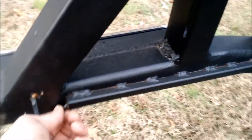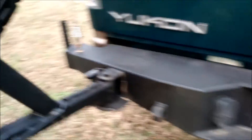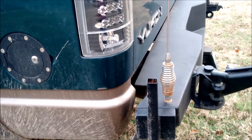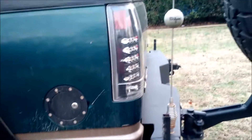To tidy up my wiring, I took some quarter-inch square tube, welded it down here alternating up and down for my wiring channel. On both sides of the bumper I have flag mounts — I drilled holes in the bumper, built a box, and it fits a copper tube inside a one-inch tube. It's a flag mount for different stuff.